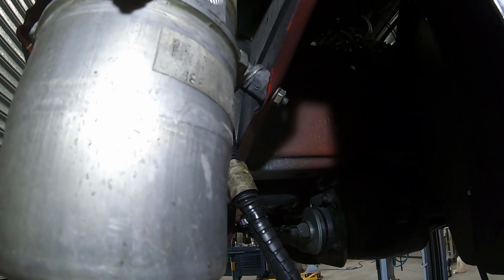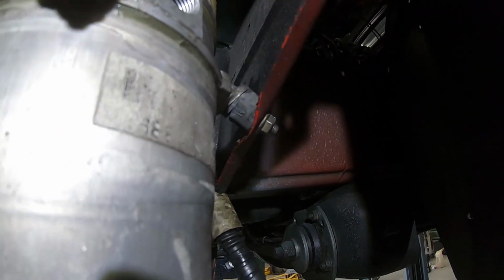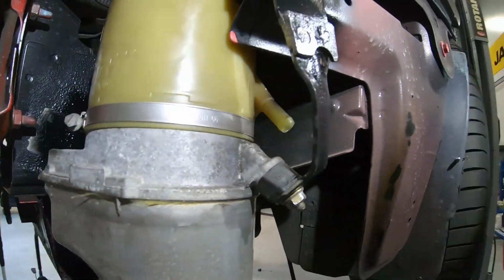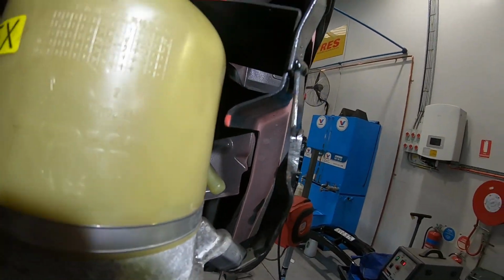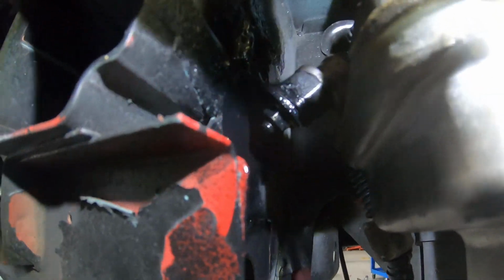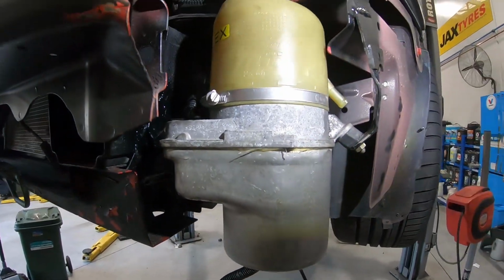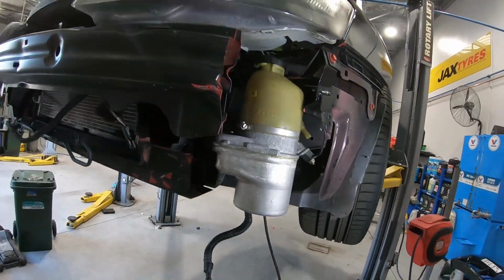Torch there correctly. Yeah, so that one was an easy one. Drill a hole, no dramas. That one's kind of a bendy bracket, and then you got the one over the back. Nice and simple, 45 degree. Weld it straight to the chassis. I don't think that'll be giving me any issues.